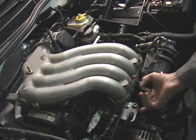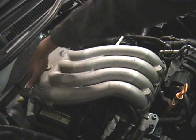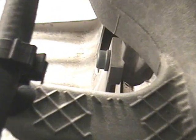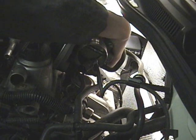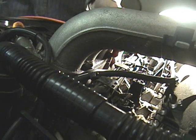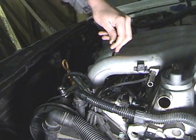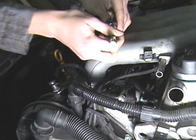There's an upper manifold and a lower manifold — you have to take off the upper. Take this off by removing this screw, this screw, this screw, and two screws back here. Behind the engine in the middle is the first bolt; the second bolt can't be seen but can be felt. Next, remove the two bolts behind the manifold. Thank you VW for putting those bolts there. You'll need a 5mm Allen wrench — put it through the manifold into the bolt, then use something to break it loose and twist the rest off.